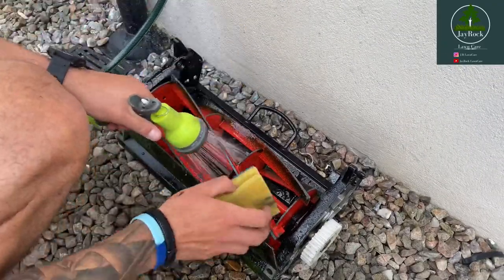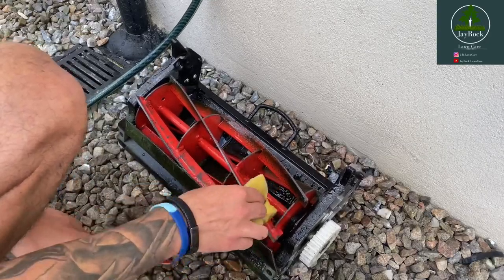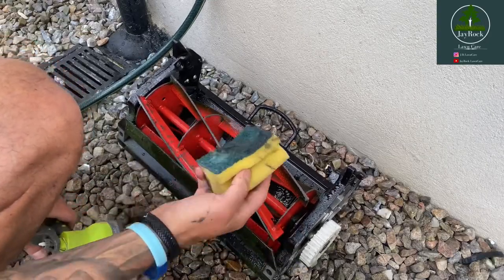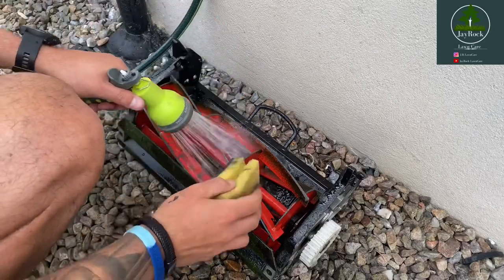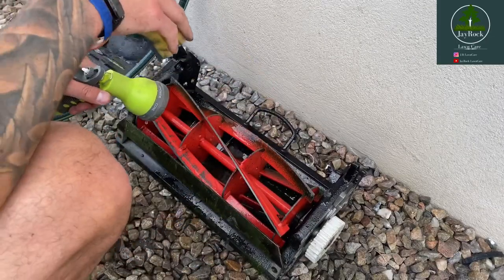The last thing you're going to do here is simply continue to wash off all that grinding paste - try and get as much of it off as possible, because if you leave it on when it's mowing, all you'll simply do is keep on grinding the blades down. So it's important you get all of that off, getting it nicely cleaned up.